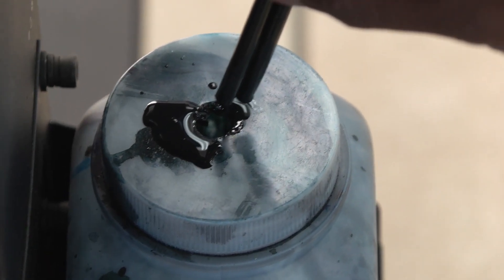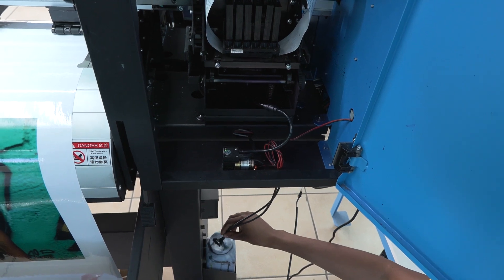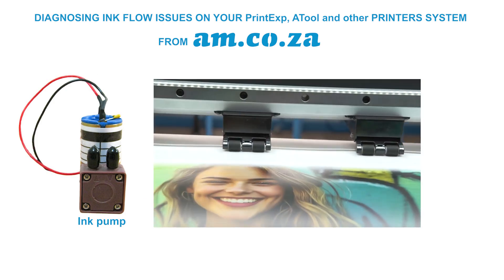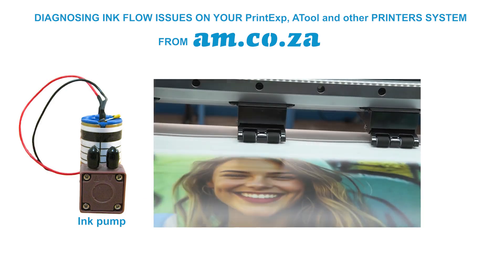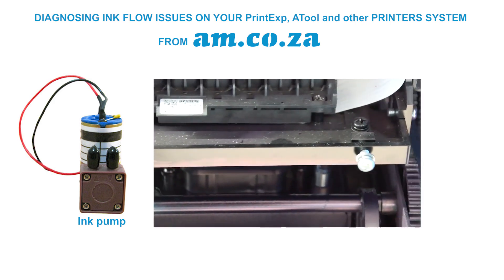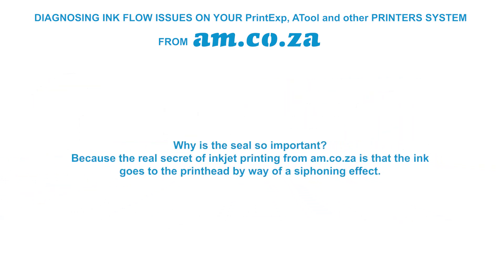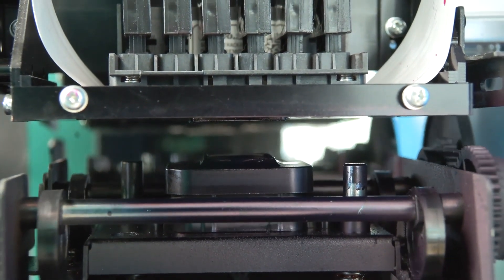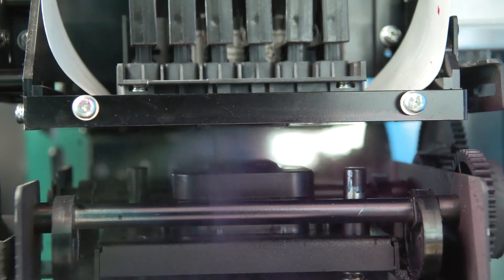All of these are ink pumps, but when we say 'ink pump' specifically, it means the pump that pulls ink out from the print head. Its objective is to keep the ink moisturized, flowing, clean, and most importantly, sealed. The real secret of inkjet printing from am.co.za is that ink goes to the print head by way of a siphoning effect — a negative pressure system kicks in when the print head spits out ink and a vacuum is created in the tiny nozzles.